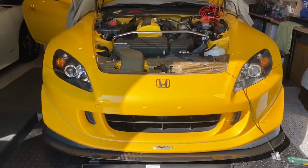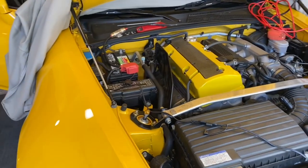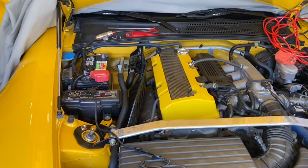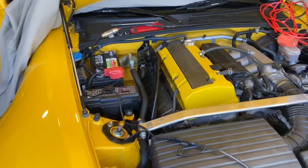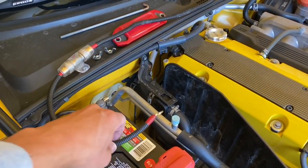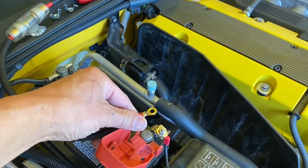We're at the front of the car looking at the battery in the engine bay. As with any amplifier installation, the first thing you need to do is run the power cable directly from the battery — which in this case is under the hood on the driver's/passenger side — all the way to the trunk where we're going to put the amplifier. I've got the cable flex-loomed and mocked up here; this terminal is going to connect directly to the battery.